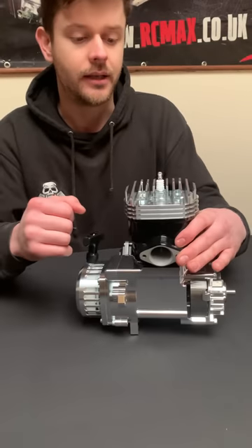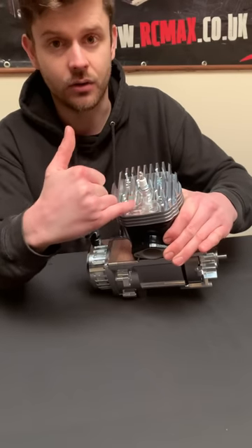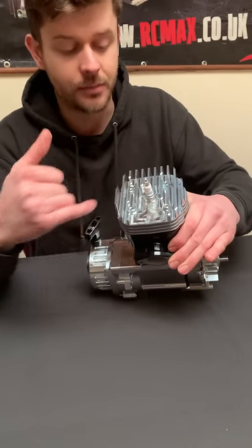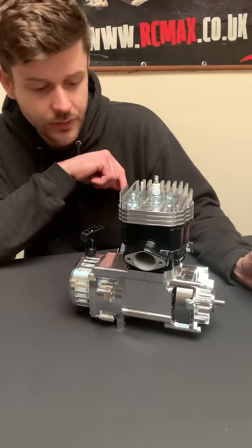The idea of using a water cooled cylinder is already out there, so we took inspiration from that and tried to improve on it. We've got the big power that comes with modern water cooled cylinders, but we're actually keeping the internal temperatures down, making it so much more reliable and easier to tune. You don't have all the latent heat within the crank cases that can transfer to the carburetor and clutch. The RC Max skull and crossbones logo is going to be machined on the space on the case - I just didn't bother for the prototype.